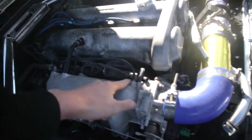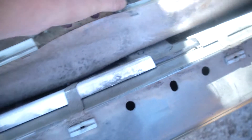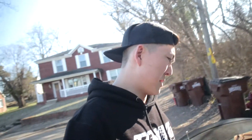I finally got the map line right there — it goes down into that hole I drilled, and on the other side it comes in from behind all this AC stuff, down right there, through this tube, and back here to the ECU. I got the tuning cable plugged in. I'm going to have that go through the center console right here with the latches so I can just flip open the little cover and plug in my PC. Now I'm going to put the seat back in, button everything up, and we're moving on to the wideband.